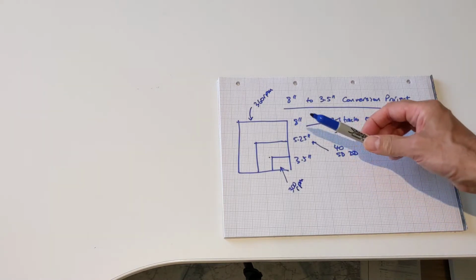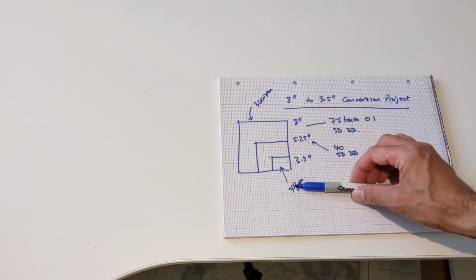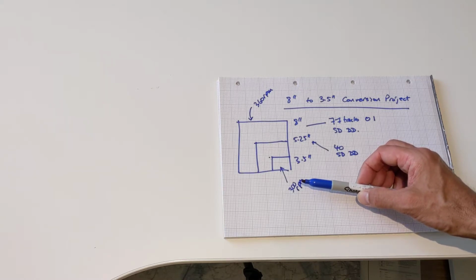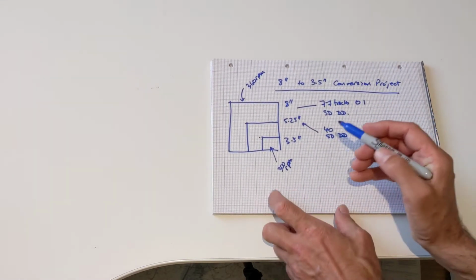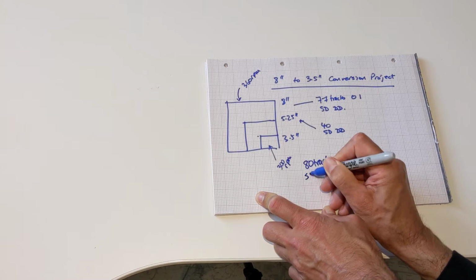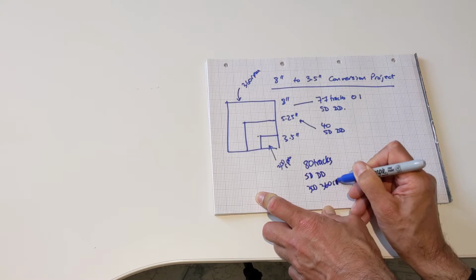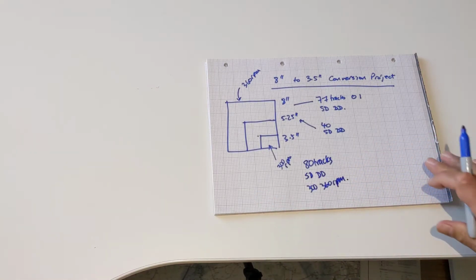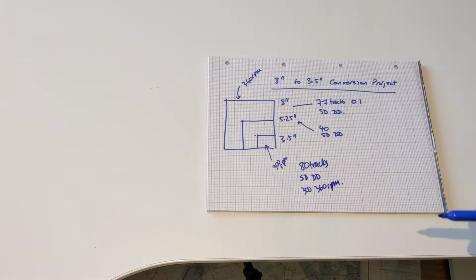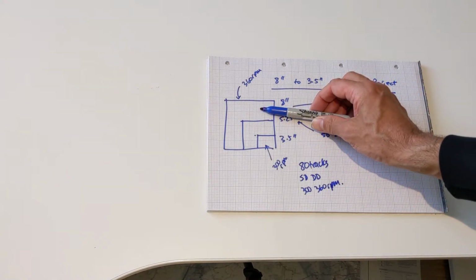So it would be impossible, because of the data rates, to put the data from this 8-inch drive onto a 3.5-inch drive. But there were some 3.5-inch diskette drives made in Japan which had 80 tracks, single density or double density, and 300 or 360 RPM. And they had an electrical interface that was basically the same as used on the 8-inch drives. So bingo, we have a solution to our problem, which is that this media is getting very old.